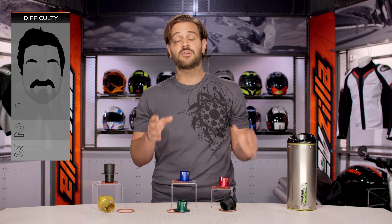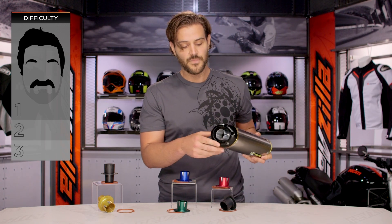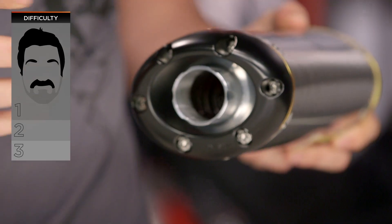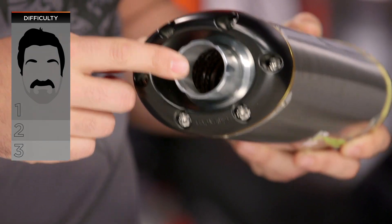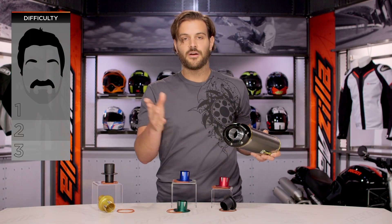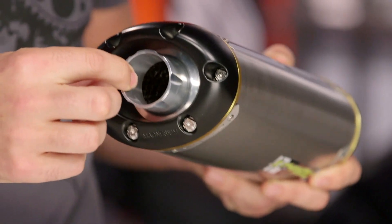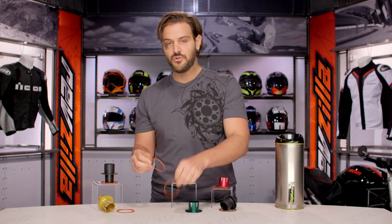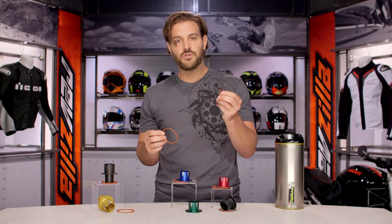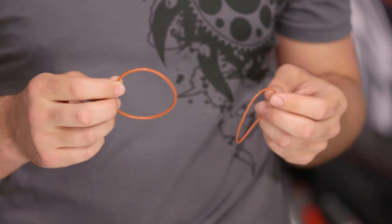Install for both of these on our BSD is less than a 1 out of 3 — super simple. On the M2 exhaust on my left hand side, I went ahead and threw one in. You simply have a few Torx bolts holding the end cap on, slide the end cap off, and there's a little notch in there. You slide the power tip in and it locks into place, throw it back on — 4 to 5 minutes tops, you're ready to roll. If it rattles around at all, Two Brothers provides two different size gaskets. Use the smaller gasket if it's rattling a little, or swap to the larger gasket if it's still rattling. It's really that simple.